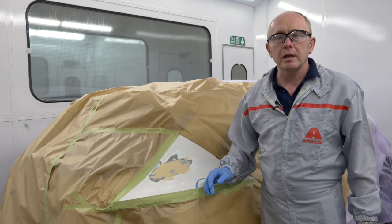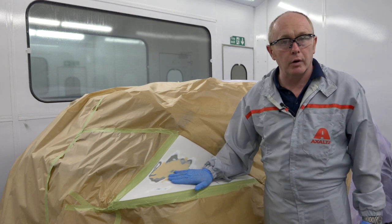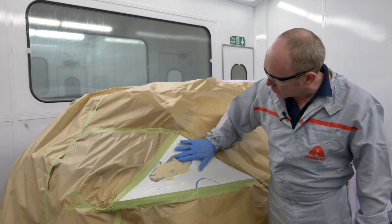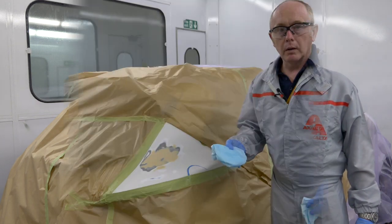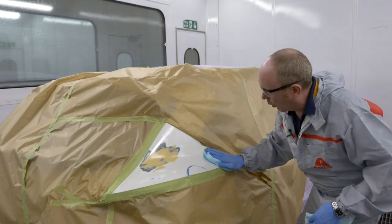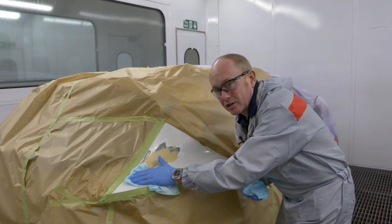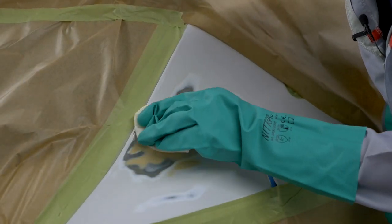Before I begin application, let's have a look at the job. The repair is finely sanded and well prepared and ready for undercoat. For the bonnet I'll come back to that later. I'll start by using the wipe on the bare metal and after a very short flash off I'll apply the surfacer or filler. Make sure the repair is properly clean before using the pre-treatment wipe. The wipe itself is there to apply a corrosion protection layer and is not for cleaning the surface. The wipe itself only needs to be used on the bare metal area.